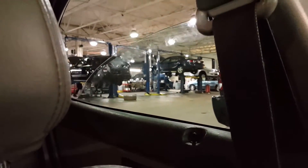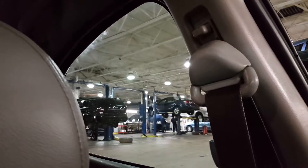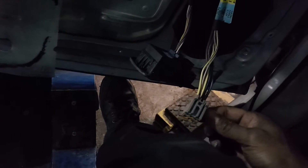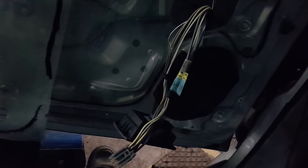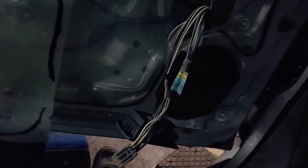I've had situations like this before in the past where it was problems with the wires, the loom up in here, wires that go through the door. It could be a master switch, it could be the switch for this window itself, could be the switch for that window — switches can go bad at the same time. So pretty much I've already tested the switch itself.